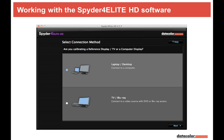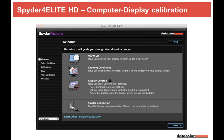Okay, good. And so next question is what to do? We decided to go for the computer monitor, and I'd like to go through this process with you to help you to see that it is quite easy to do. So what we do, you have to wait for warm up, because during the warm up, let's say half an hour, the colors will change, they will shift on screen, and that wouldn't help.